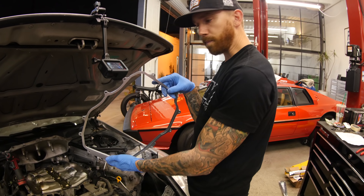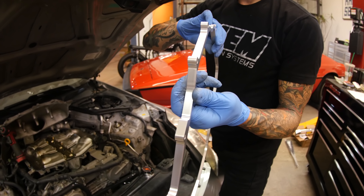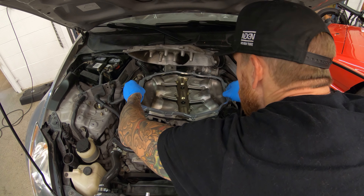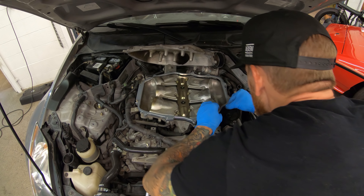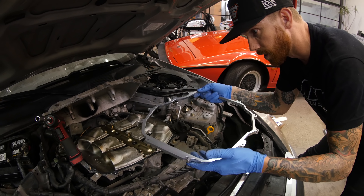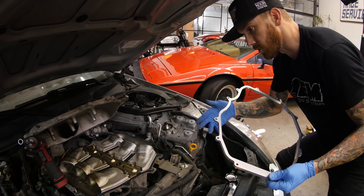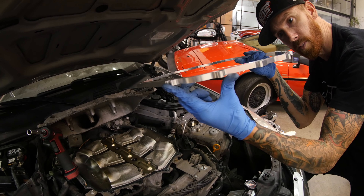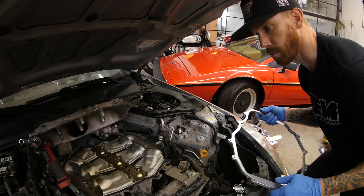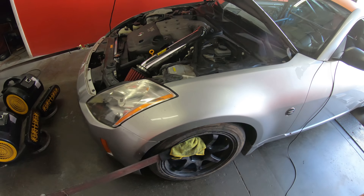This is a machined piece of aluminum from one big block. If you look at it closely, you'll see that one side is thinner than the other — what that does is it gets equal airflow to the front and rear cylinders and levels out the upper intake manifold. All the ports have to come in through the throttle body, down and around, and into the actual ports in each zone. This equals out the airflow because dyno testing found the front cylinders were working a little too hard, so giving them that extra eighth of an inch evens it out and gets power even across the board.